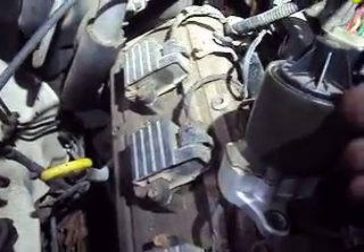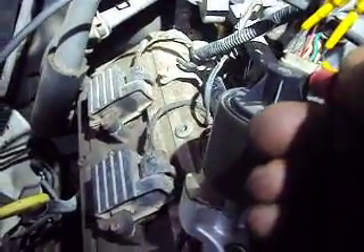Here I'll show you a quick check of the solenoid — whether or not it works. This is a nice use for your Vantage because it is an amp meter as well. All you do is ground out the control side of the EGR valve as the PCM would do. If we look at the Vantage — it's kind of hard to see on the camera — you can see a current ramp. I've got it set on a 5 volt scale.